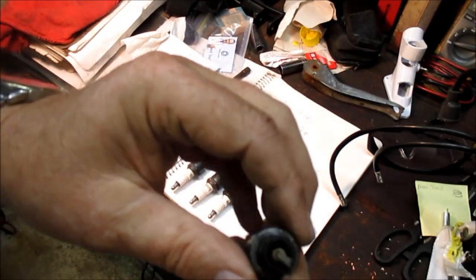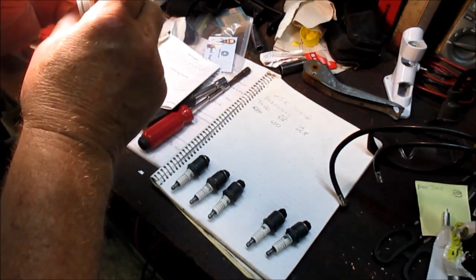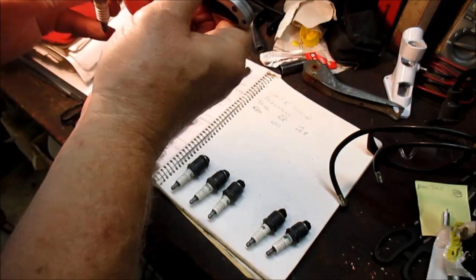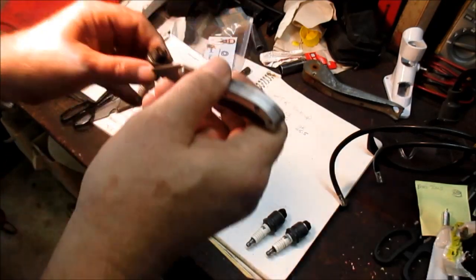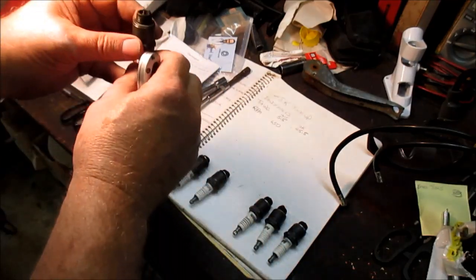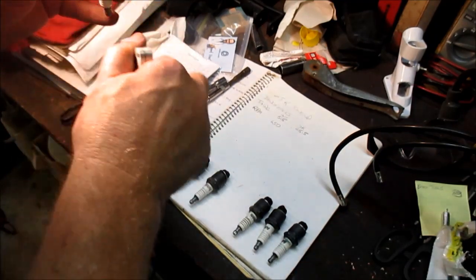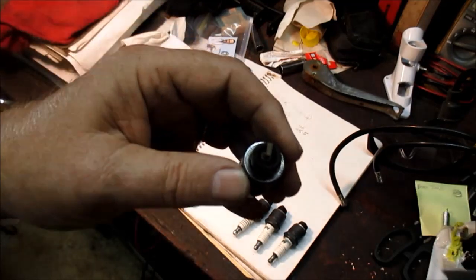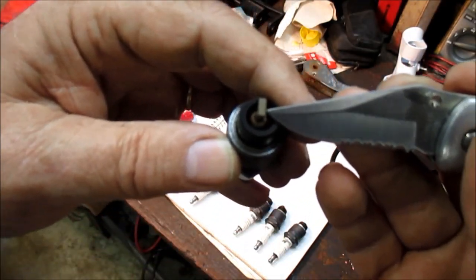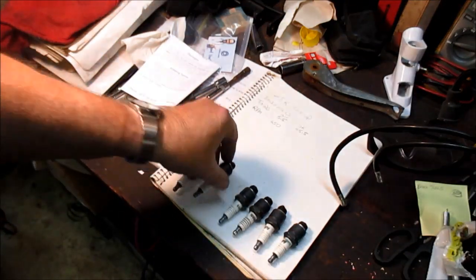Number 4. I'm going to move him over here where I can look real quick. Now he doesn't have hardly any timing mark, that discoloration that I'm talking about. Now that would indicate retarded. Okay. There's number 3, and it's smaller. The mark is shorter on the plug, about to here, which would indicate it was retarded some. You want it more advanced. Okay. Number 2.